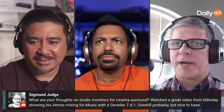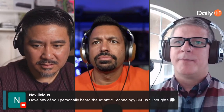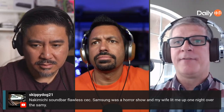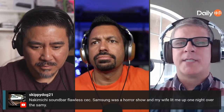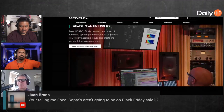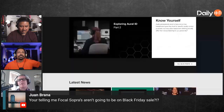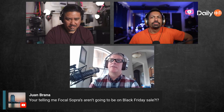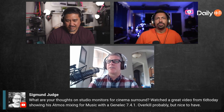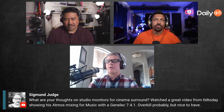Those are powered speakers, which seems a little weird to me for a home setup. With a 5.1 or 7.1 system, you need power going to every speaker, and you typically want your surrounds at your ear level or a little above — so now you've got a cable running down the wall. It's harder to set up, and you've got to figure out how that works with your AVR. If everything is active that's one thing, but if your LCRs are passive you'd need to prepare for two cables going to each speaker — one for power and one for the pre-out.